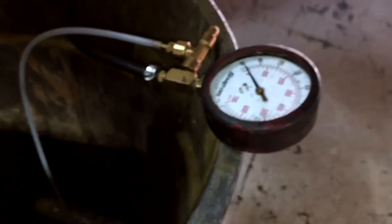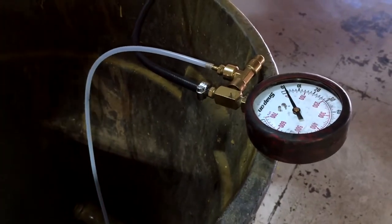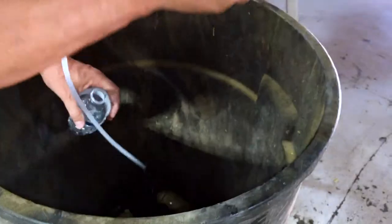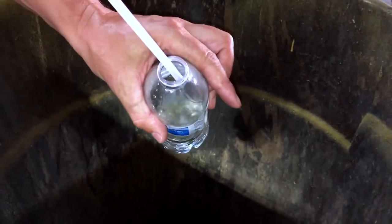All right, Craig, you can come down. Now I'm going to go up here and actually probe the positive side of the pump. I've got the ground of the power probe already connected, and right here we've got the fuel pressure tester. When I activate the pump — we can hear it — but we have no pressure. You can see the gauge. Go ahead and squeeze the release trigger and show that gas is actually coming out, but slowly it's coming out. So there — that's just not enough pressure. We've got gas coming out, but there's just no pressure.